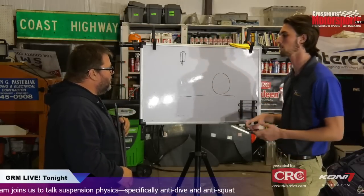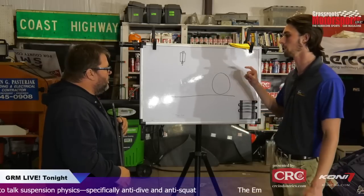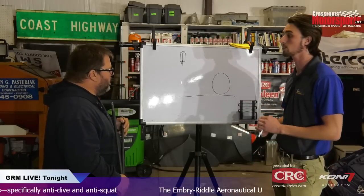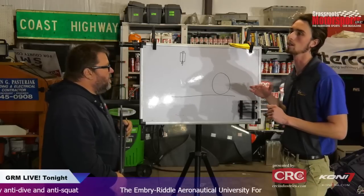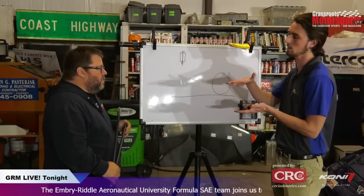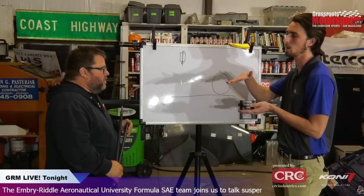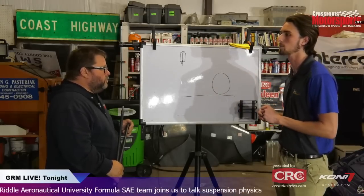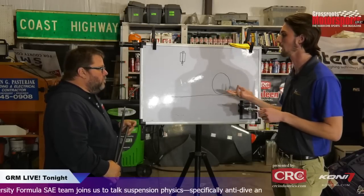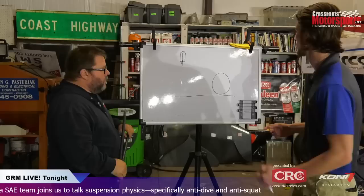This was the same way we had the bracket done from last year. We just extended it from an inch to an inch and a half. Oh, cool. And then it gave us some more variability in there. We actually ended up angling the suspension bars on the chassis slightly to give a little bit of nominal anti-squat, like it's already at some small value. I forget exactly what it was, but we did do that to aid in that. Okay. And then so back to this.